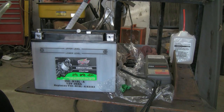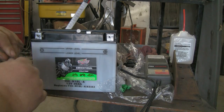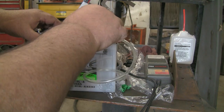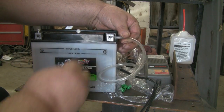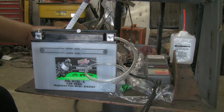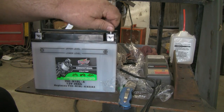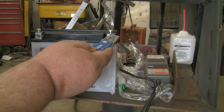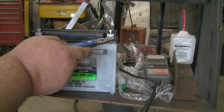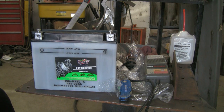What I like doing on these bike batteries or ATV batteries is taking a piece of tubing — it usually comes with the battery and is meant for a drain tube. It's just cheap vinyl tubing. Stick it in underneath the battery terminal clamp area, push the nut on, and then slice off the excess. What that does is it holds the nut up to the top so when you're putting on a battery with multiple terminals there's room to stack them up and get the thread started. You tighten it up and all that happens is it squashes the vinyl tubing. It's just to help hold the nut in place, and if you take the battery out the nuts don't fall out because they're held in place with the cheap vinyl tubing.